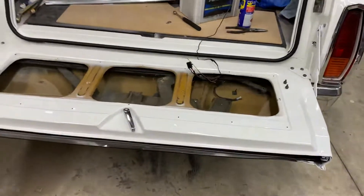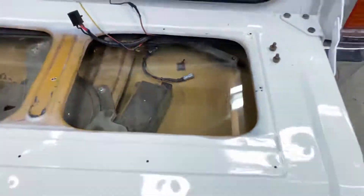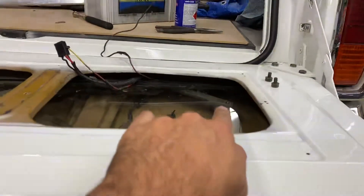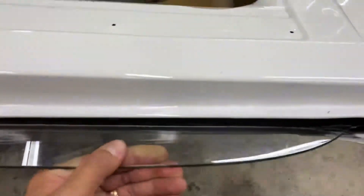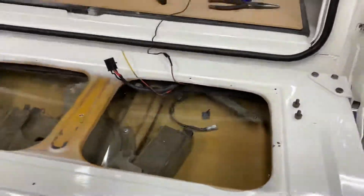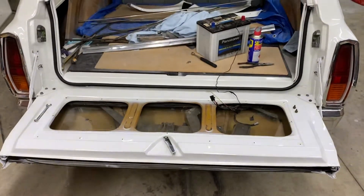Eventually that'll let go and I'll be able to slide the whole window out. I'm not going to show you all of it, but that's how you get it out if your window's stuck and you're on an electric system like I am and you do something stupid like I have. Two bolts under that side, two bolts under that side — that'll loosen the window and you'll be able to manually pull the window out. So that's how you do it folks — HQ rear tailgate electric window.